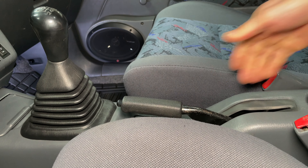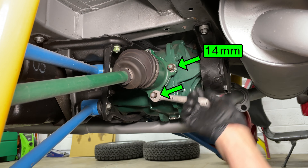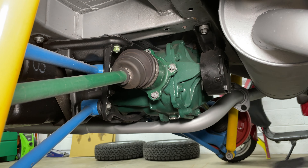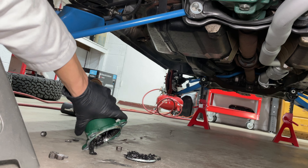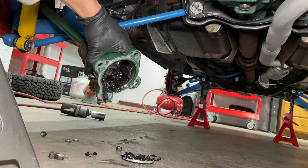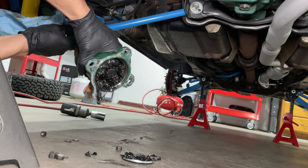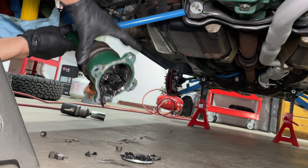Release the parking brake, then turn the axle 180 degrees so you can reach the other two nuts. Engage the parking brake again, then use the 14mm wrench to take the other two nuts off. Now the CV axle is ready to come out — pull it straight out, off the bolts. As soon as I pulled this CV axle out, this cap just fell off of it. And here you can see the play inside of the inner CV joint. That's real good quality there — that Chinese trash right there from AutoZone. Gross.